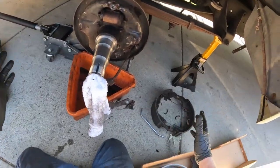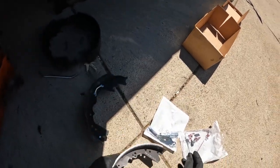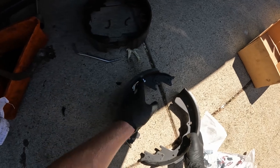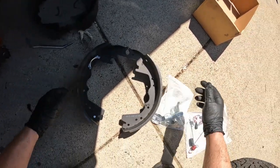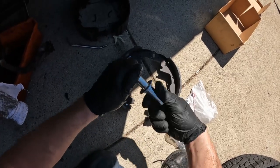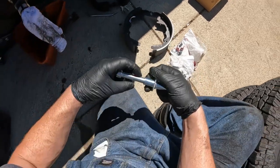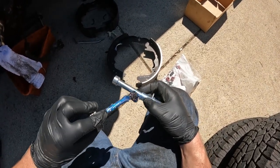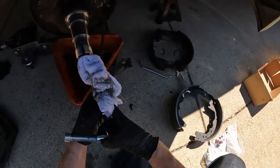Change your gloves so you don't get any grease on your new shoes. Lay the new stuff out just like the old stuff. One shoe has the cable loom where the emergency brake cable goes. The circle thing goes at the top. We've got new brake hardware — take the adjuster apart and put a little bit of caliper grease on it to keep it moving freely. Just a real thin layer — you don't want it attracting too much brake dust. Roll it back in almost all the way, leaving about a quarter inch out.